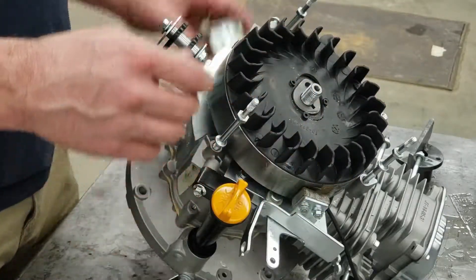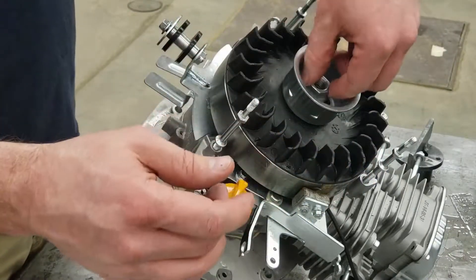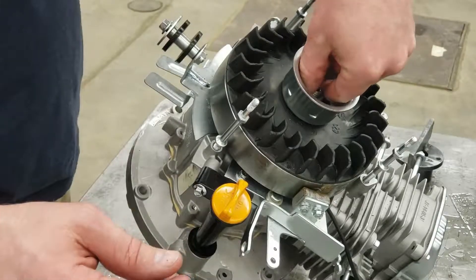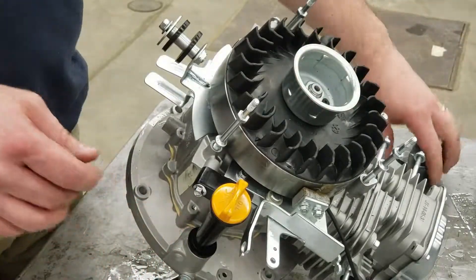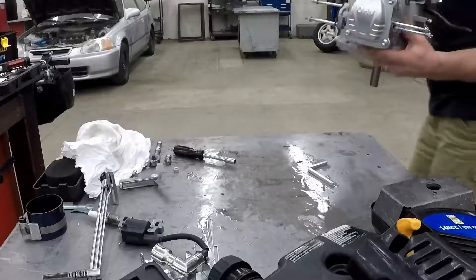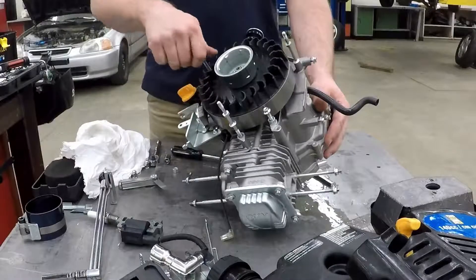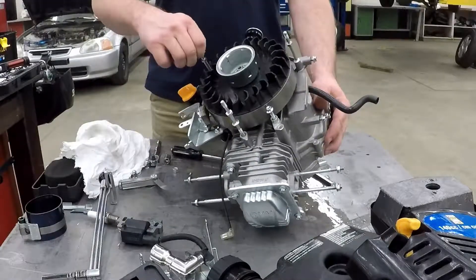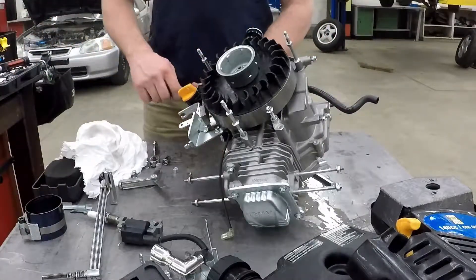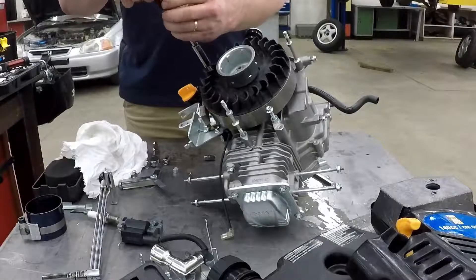Put the flywheel cup — also the starter cup — on, spin the nut on, then take it away and torque that flywheel nut. We had video instructions on disassembly: you do the same thing — put it in a vise with a crankshaft holder and torque it to specifications, then write down the torque. Now we have to make sure everything is tight. These blower housing studs need to be torqued too. If a wrench doesn't reach, just use a deep socket — it will fit all the way down around the hex head to torque it.